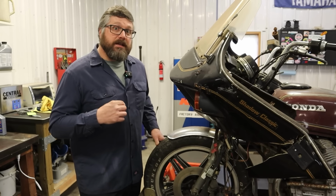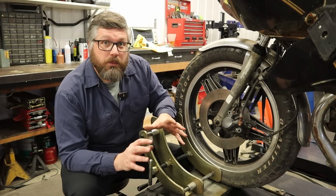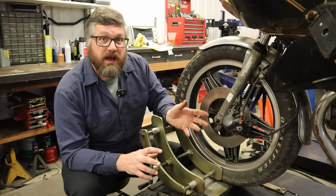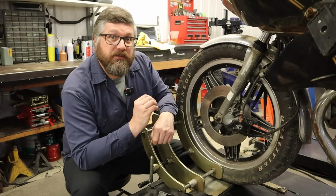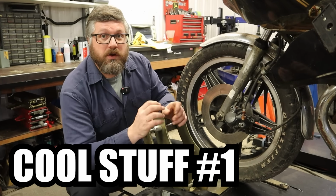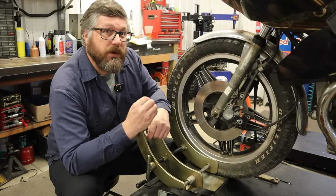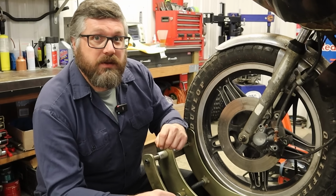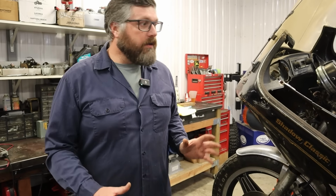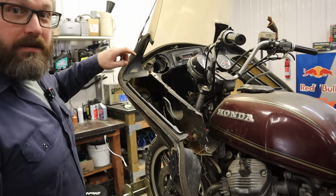Yeah. These bikes ran a single front disc on the front and ComStar wheels. So while the ComStar wheel was released in 1977 on the Honda CB400 Dream, 750 and maybe the 250, the CX500 was the first production bike to run a specifically designed tire to be tubeless. These ComStar wheels were known for giving you the flex of a traditional spoke wheel while allowing the tire to go tubeless.